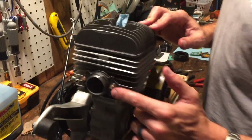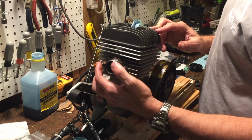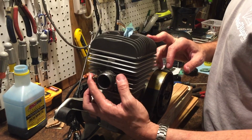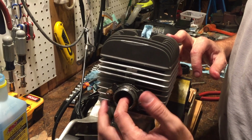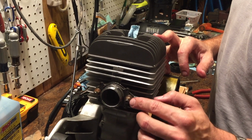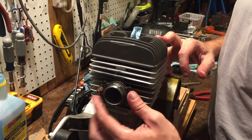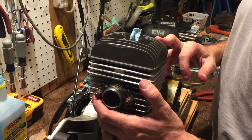While we had it out, we also had new studs put in, and the new 10mm locking bolts. We didn't have these 13mm that were just nylock. You can't use nylock on something that gets that hot, because the manifold heat coming out of here is a couple hundred degrees over your head temp. So you need these locking copper bolts and the washer behind that, so it doesn't heat and loosen up, and then you're getting oxygen in there, so you're going to lose your vacuum.